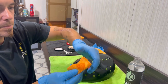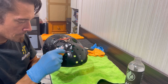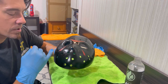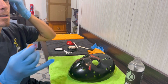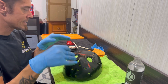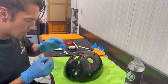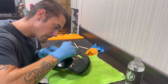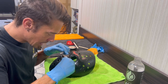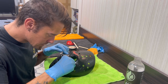Now I'm going to take a dab of the mineral spirits — you can see here how there's excess around the edges. You just go like this and it will basically strip that off and clean up the line, and it won't affect your underlying paint. Mineral spirits really only affect oil-based materials, so if you're using a lacquer or an acrylic enamel paint it's not going to affect it at all. When you're doing this you'll notice it gets smeared around, so you're going to have to rotate your towel because it'll spread the product around — and we want to remove it, not spread it. Use both sides of your towel.